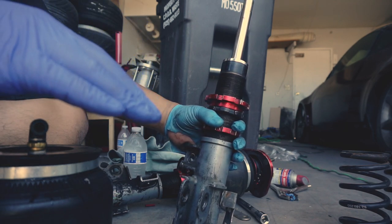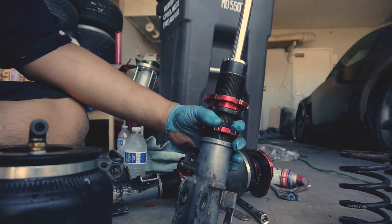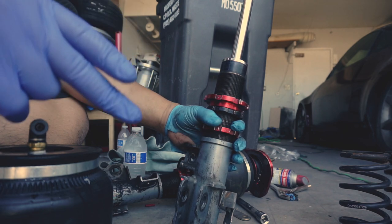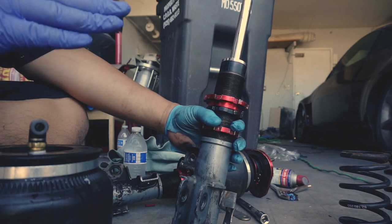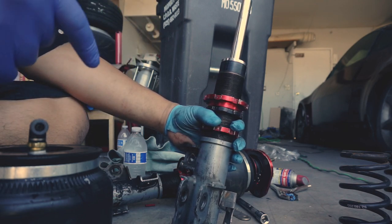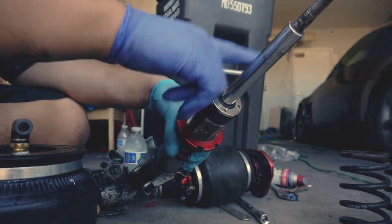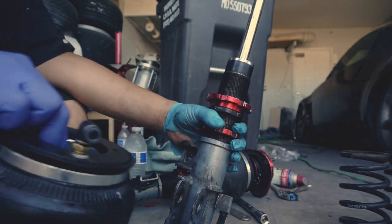Here's pretty much how to install the bag. If you guys haven't seen my video, make sure you go to my channel and look for my airbag videos — I have a full installation on how to bag your car on the Airlift 3P management. Go ahead and check that out. Here's a crash course on how to do a bag-over-coil-over setup: pretty much you take your shock, remove the spring, and get your bag.